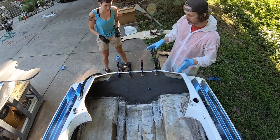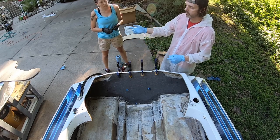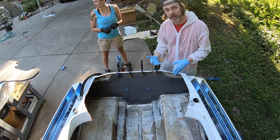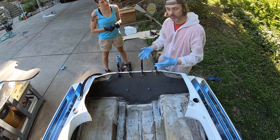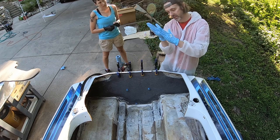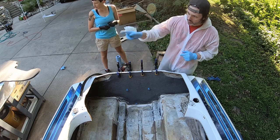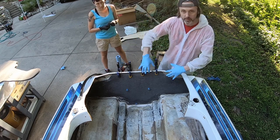All right, so now that this is set up, we're going to take out all the clamps and the bolts, and then we are going to throw in the new transom, drill the holes again. The reason we didn't transfer the holes right away was they kind of sit at an angle, so if they were exactly the same and then they sat at an angle, the holes wouldn't line up. So we're going to drill holes in that, transfer that to the cloth, and then install the second layer of COOSA.